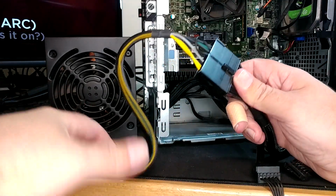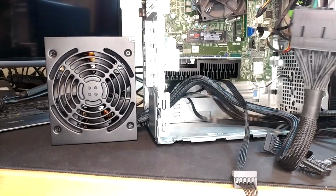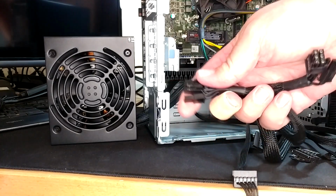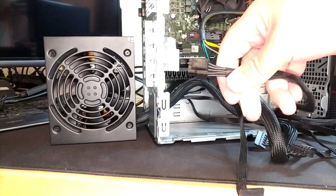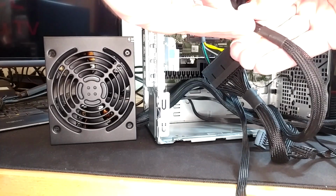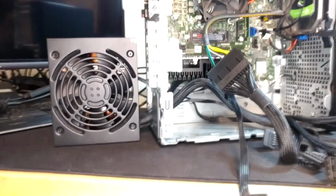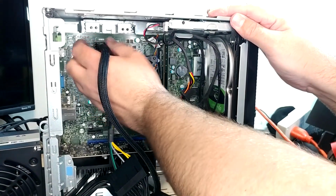Here is our Mod DIY adapter, functioning exactly like the last one. I'll plug that guy into the ATX, just like we did on the other one. And there it goes. We have our broken out PCIe power again with a 6 or 8 pin option, which is something the Dell didn't give us. And here they have ganged the CPU wire harness up as a double to begin with, and it looks like they do come apart somehow, maybe. I'm wondering if I even need to worry about it. It looks like those probably are 2 different connectors. I'm just going to try and plug it in as one. So here's our double guy. That's where it's going. It might be kind of fun to get this to release later. Anyway, it plugged in perfectly.